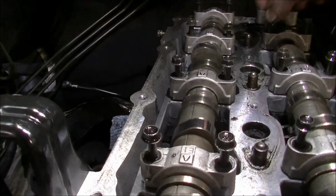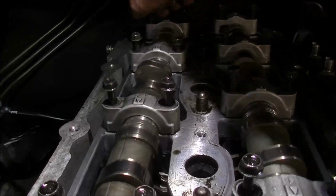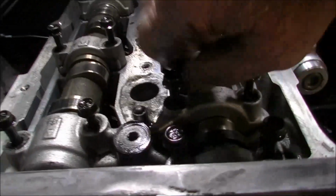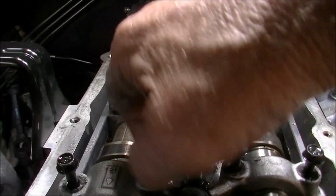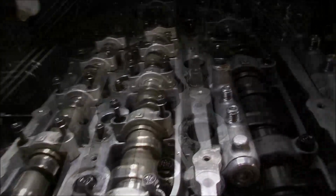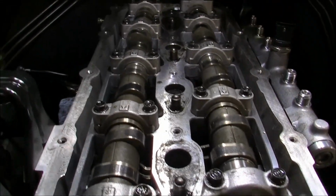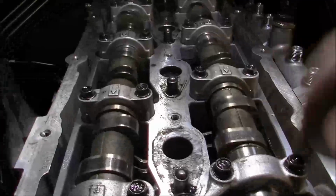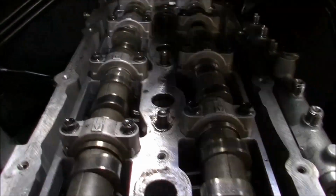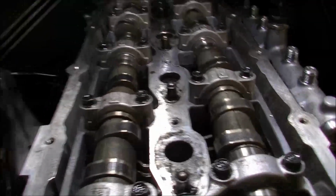I never worry about turning the cams while I'm pulling them down. Just try and pull them down nice and evenly. You don't want to go breaking things and stripping bolts and breaking camshafts and messing up stuff. So I've been up and back, to and fro, here and there. Just evenly back and forwards. Don't go crazy on the tightness of them. They're only little bolts, they're not holding the planet together. Next we'll pack this bit on. It goes in the front here.